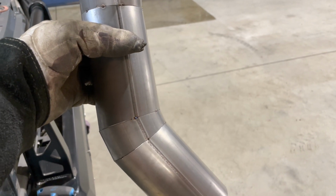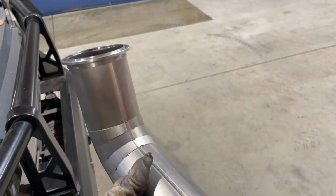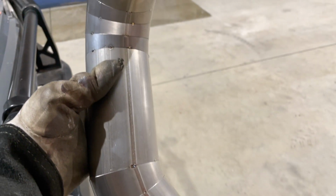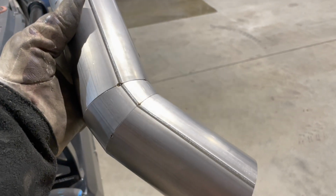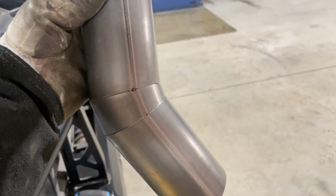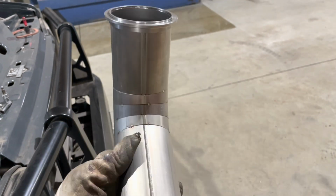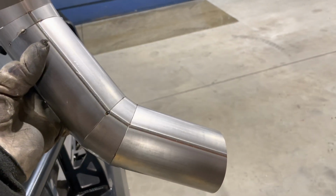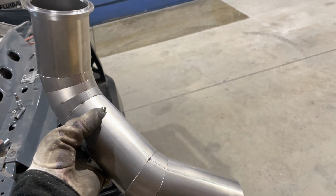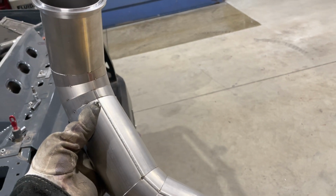The next plan of attack is to start joining to the bottom half, but one of the key things I want to achieve is having that line in the same orientation all the way around. I've had to spin the cuts round on the bandsaw to get that pie cut correct, but ultimately I think that's the right way to do it. It looks loads better, a bit more time consuming, a little bit of wastage, but when it's on there, look at it, that's going to look proper. So we'll get that bolted up.